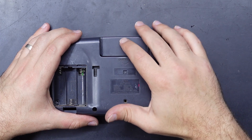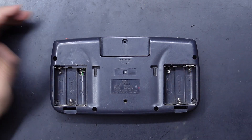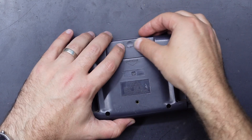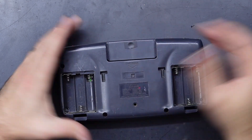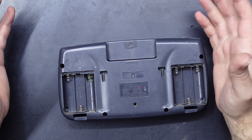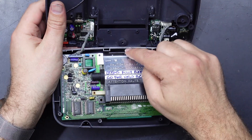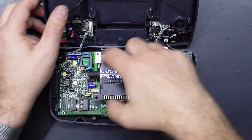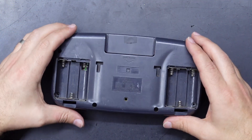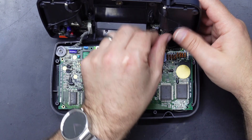You will need a game bit 4.5 driver for those particular screws. I'm going to cover up the hole for that one screw right now before I forget, because we won't be putting a screw back in there. With all of these replacement LCD screens, that screw always gets covered up and the actual post inside needs to be cut out in order to fit the new screen in there. I cover it up just so I don't forget and try to push a screw in there and damage the new screen.